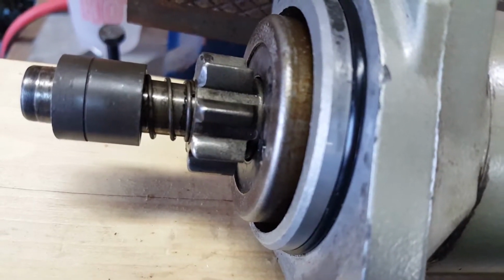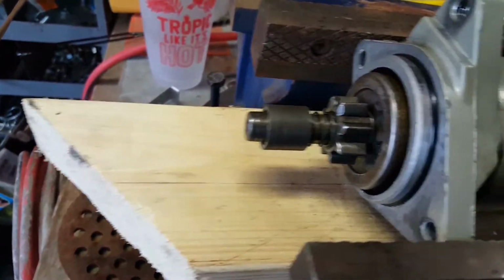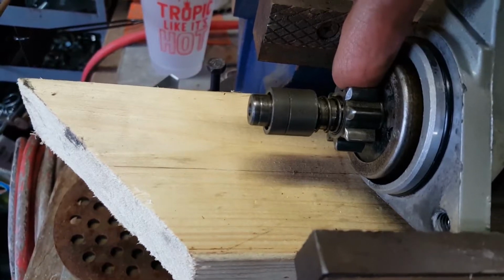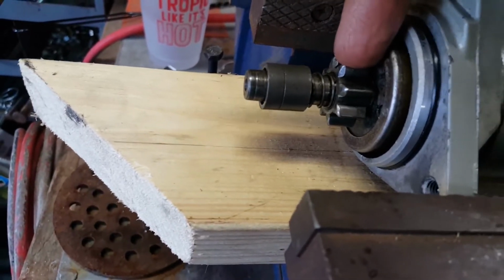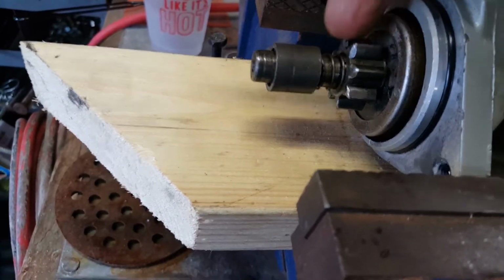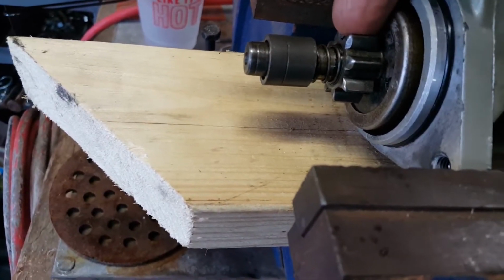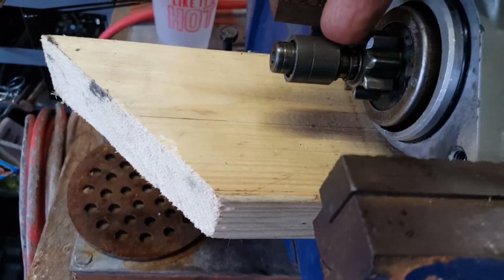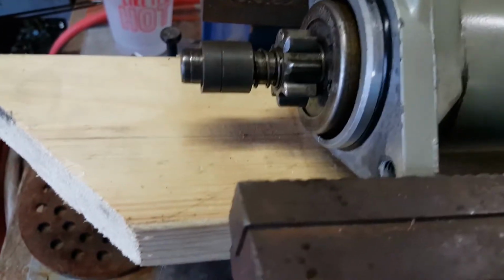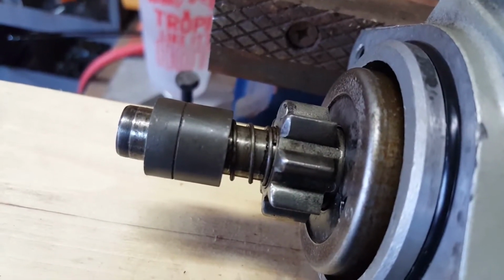So we'll let it spin up now, and you'll see that kind of start drifting back, because the shaft of the motor instantly goes up to speed. But once this thing here starts, it's the inertia of this not being able to catch up that runs it up that spline. So once this here catches up to that speed, then you'll see it start to drift back just slightly. Except that when you are starting your engine, it doesn't do that, because by the time it goes up there, it engages into the flywheel. It's held in place until you take the pressure off of that, and then that drifts out. So if the engine starts, that thing just is forced straight back down. So we'll start it and hold it there, and you'll see it drift back just slightly.